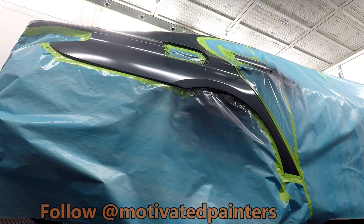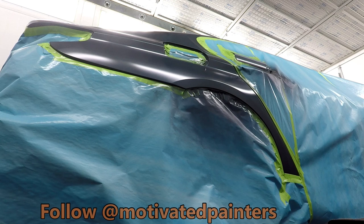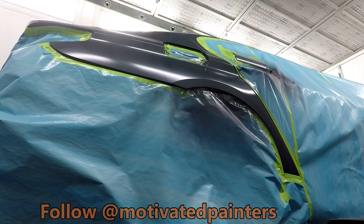I applied the second coat of clear after the first coat was completely flashed off. You can see it going dull over the course of about 10 minutes. Once it goes practically completely dull, then you can bake it — because if you bake it too soon it might stay shiny. You need to let the solvents release and get out, which is really important when doing matte finishes.